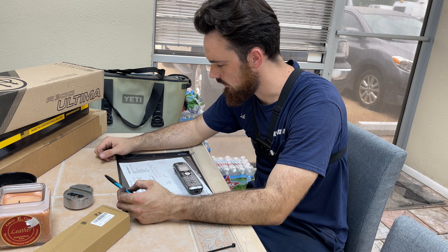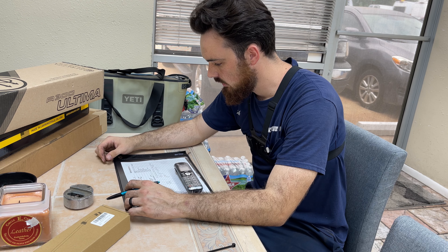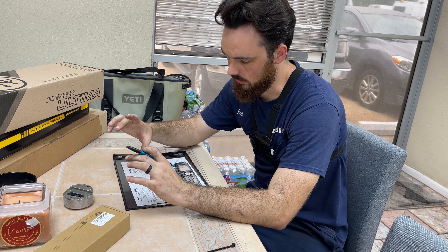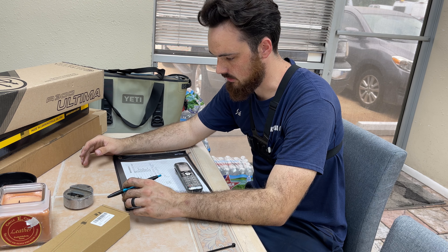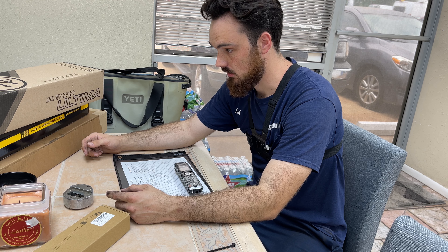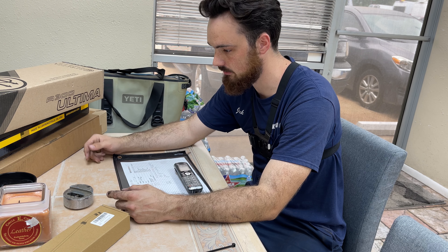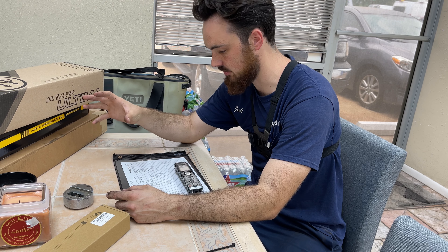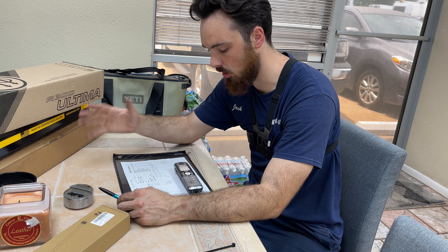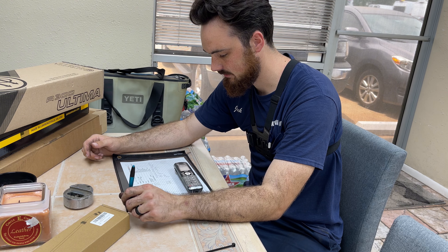Hello? Hey Carla, it's Jack with KD Auto Care. Hey, Jack, how are you? I'm doing pretty well. We've figured out what's going on with Amy's Jeep. What is that? So this thing has a broken water pump — what happened was the pulley on the water pump just completely sheared off. And so basically the whole belt and everything just came off and got shredded. That's what happened — she wasn't on the road, she had just come in from Austin when all that happened. Yeah, that's actually a very good thing that it happened here. So that's why there's no AC, there's no power steering — because the belt came off, and the reason the belt came off is because the water pump pulley basically just sheared off. We'll have you done either toward the end of today or possibly tomorrow morning if that's okay. Okay, yeah, that's fine. Alrighty, I will get it done and I'll call you. Okay, thanks. Bye.